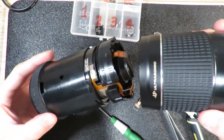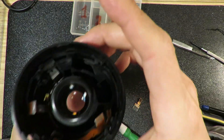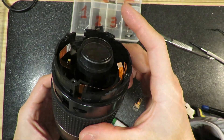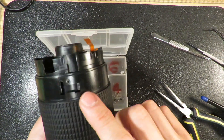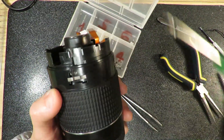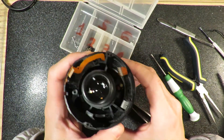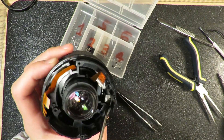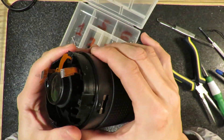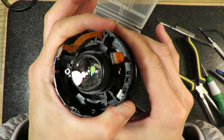Now it's time to put the zoom ring back. I think there's only one place you can put it in — and after that everything nicely fits. The brush is back. Now we need to put back this hook — you have to use a little tricky thing, try this, try that, before you install it back. So now you can see the hook is perfectly aligned with the zoom. If we give it a try — everything is good now.